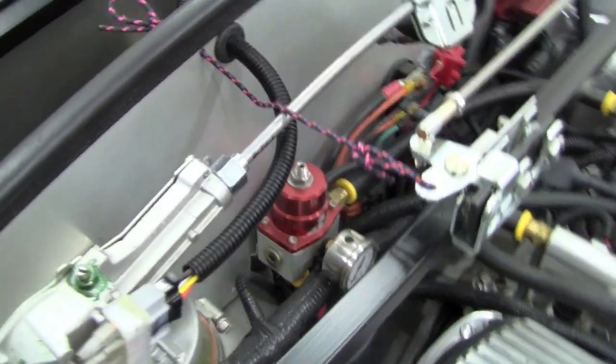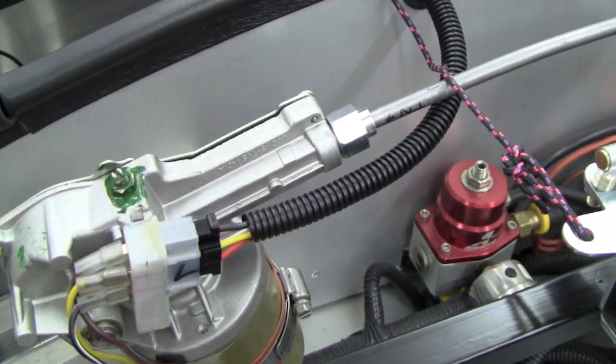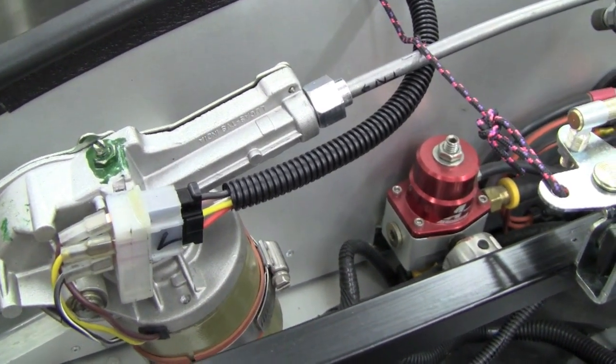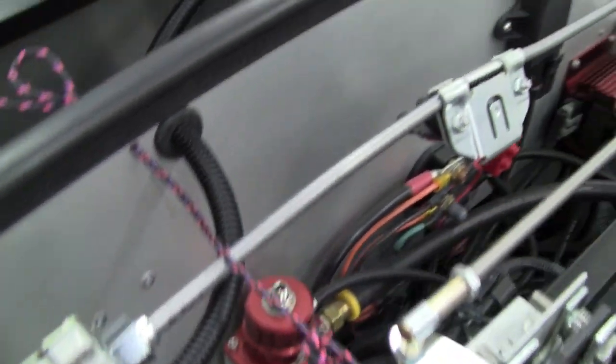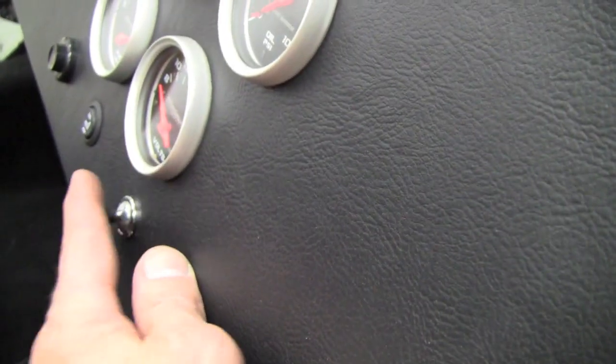To finish out the wiper installation, we bought a plug from Cobra Accessories Finish Line to hook the wiper up officially and use the park feature. Our wire comes through the firewall, across and down to our wiper switch on the front of the dash, which is a two-speed switch with park feature — also from Finish Line.